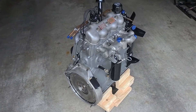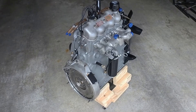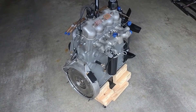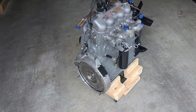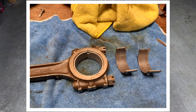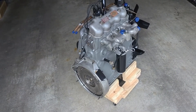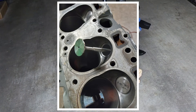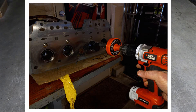The rebuild on this was not difficult — it was in good shape despite sitting for quite a long time. It remains on standard bore and standard bearing sizes, so it really just took a bunch of cleanup. All the bearings were replaced: mains, connecting rods, cam bearings. It had one intake valve with a big chip out of it, so that needed to be replaced. Everything else was just lapped in without difficulty.